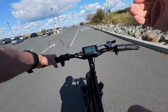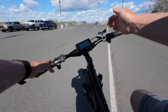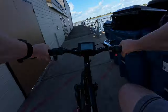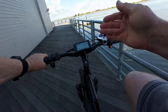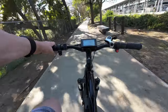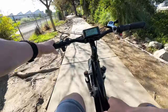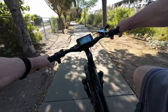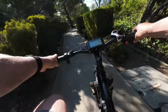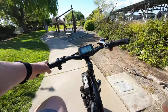As I've tested more of these bikes, I can appreciate that Sonata's pedal assist has a smoother delivery than a few other bikes I've tested. This is rated at 1000 watts but the controller is a 48-volt, 28-amp controller, meaning you can put out a peak of about 1350 watts. Overall, the Sonata bikes stand out for smoother power delivery, being quiet, and the effort they put into the frame, color schemes, and paint jobs. The frames are not as big as other bikes in the market, so these feel more nimble and easier to maneuver than some of the bigger 26x4-inch fat tire models.